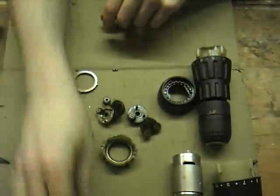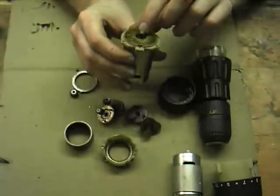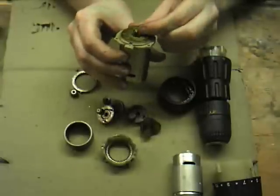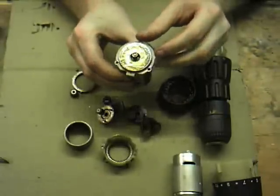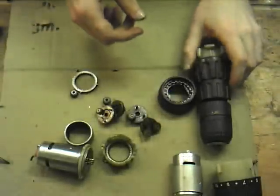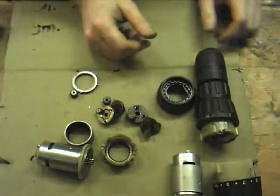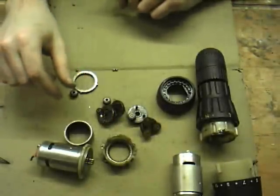But when you start considering that, you've also got to start considering the output gears here, because I believe this has a 3mm spindle on the motor with a 9-pin pinion, then you can't really drill that out. You're limited by the size of the motor shaft for what it can accept. Other drills do have bigger pinion gears, as in the case of this one here. This one has, I believe, a 15 gear pinion on the motor, wherever the motor's got to. But it's worth keeping in mind.